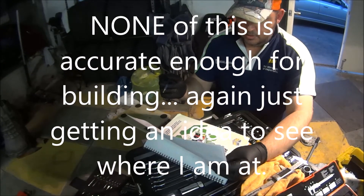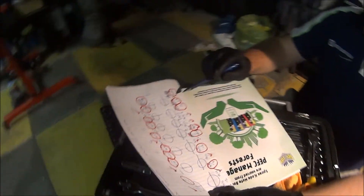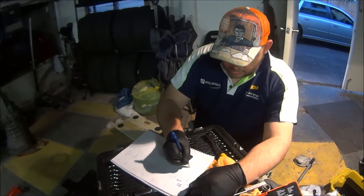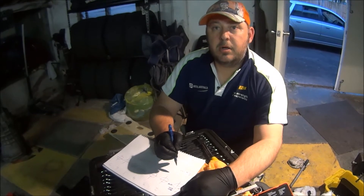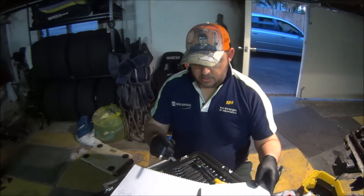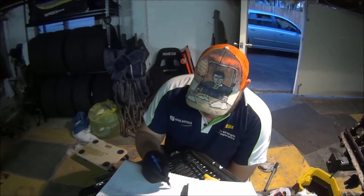Let's very quickly have a look at approximately where we're at. Same mass as before. The journal — this is the front of the engine. The front measures 54.94, 54.94, 54.94, 54.94, and 54.94. So it was round. 55 neat — so that's about 0.06. Crankshaft journal main oil bearing clearance limit is 0.09. Our target is 0.02 to 0.047.